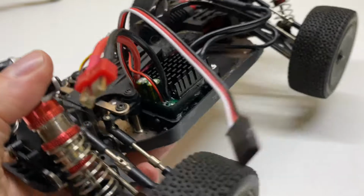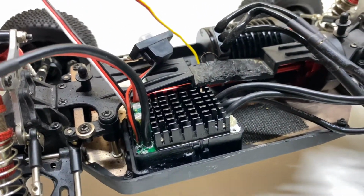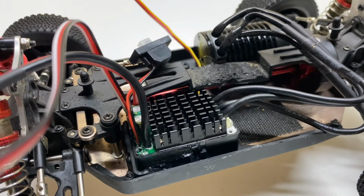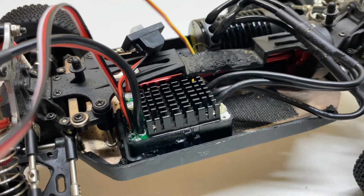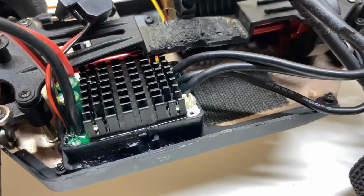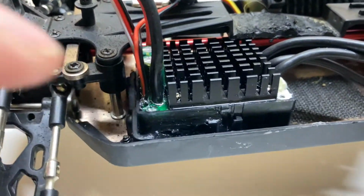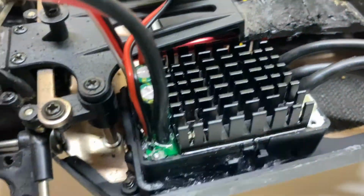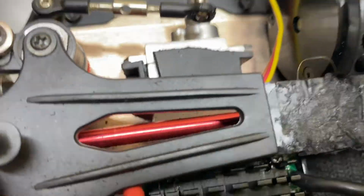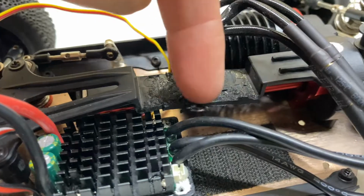Many of you might not know this, but it's always confused me why there were 5 wires. On a quick Google, we discovered that the board for the 5-wire servo is actually in the all-in-one ESC, hence why you've got to change the servo if you change the ESC on these things. So we've got the new brushless ESC, a bit of silicone around there, so we've just glued it into the chassis. Still plenty of room down the top for the drive shaft, and we've used the Dremel along the top edge where the original ESC was mounted.